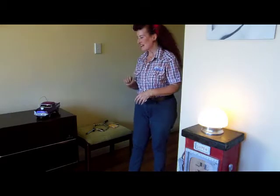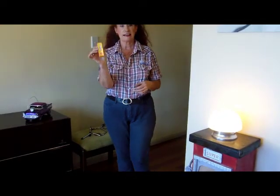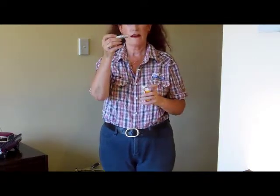This is the first episode of Pin Up Garage! Today we're doing the spark plugs. These are my NGK plugs, specifically for my engine and model of Commodore. You need to get the right ones because it depends on the heat that comes out of the plug. There are different types - platinum, iridium - and different lengths, some with hotter tips. The Camaro, our other car, has a hotter tip. These ones are just the standard ones from when it was built.